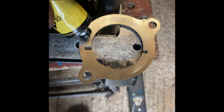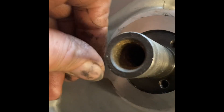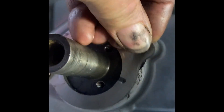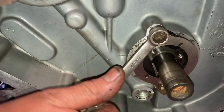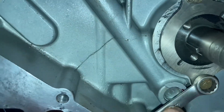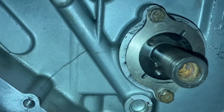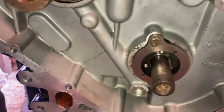We're going to start putting the camshaft thrust ring in. This will hold the camshaft in place while I'm turning the engine over, because I've got to stand it up to get the pistons in. So you put this thrust plate on and this will hold the camshaft in place and stop it sliding out of the block. Run the bolts in — I think the torque setting on these was about 13 newton metres. I haven't got a torque wrench that goes down that low, so I've run them in and tightened them up with a spanner. 13 newton metres is not a massive torque, and they've got spring washers on them to stop them vibrating loose — just a good nip, nothing massive, as it's going into an aluminium block. Give it a spin once done — all nice and free.